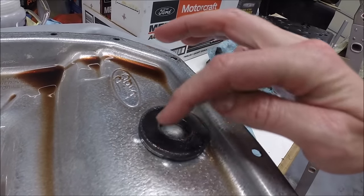Be sure to wipe down the gasket surface on the bottom of the transmission housing. Then we're ready to install the transmission filter, which just presses and kind of snaps into place and hangs there. Then we get the pan back up to help hold it in place. Don't tighten the pan bolts yet - just get them snug. We'll get all the bolts in and slightly snug, then go through our torque sequence starting from the middle and working our way out.